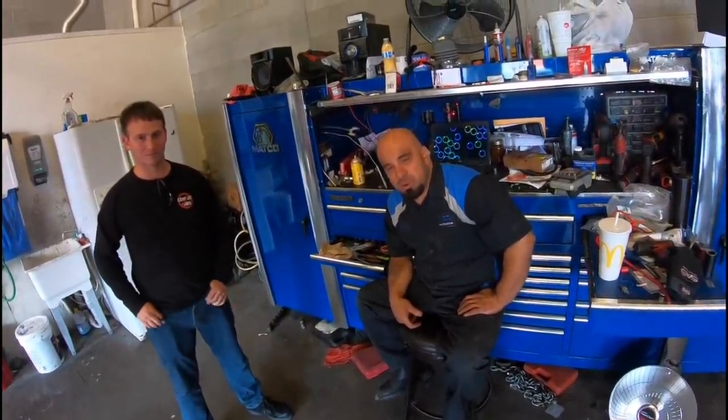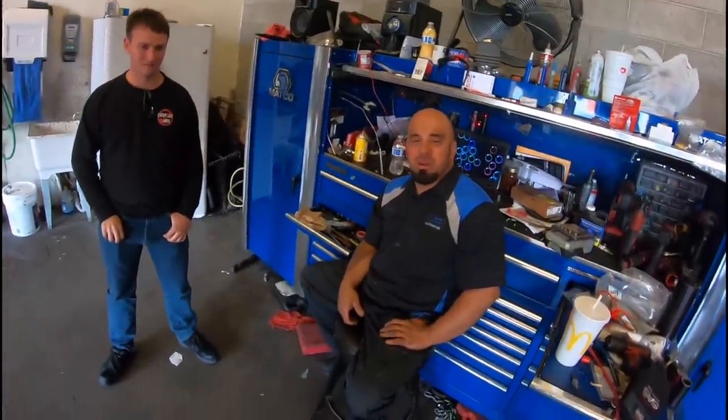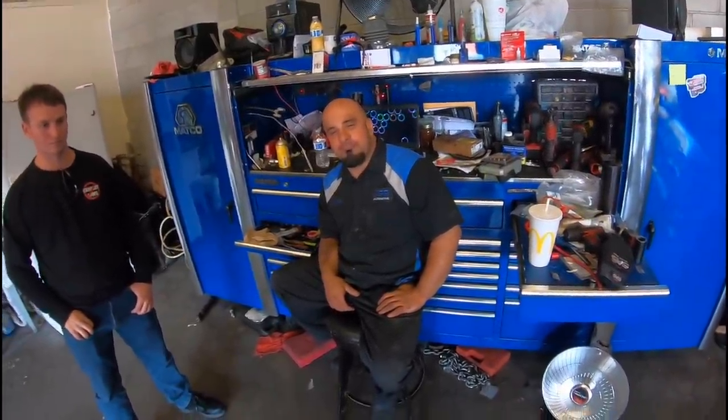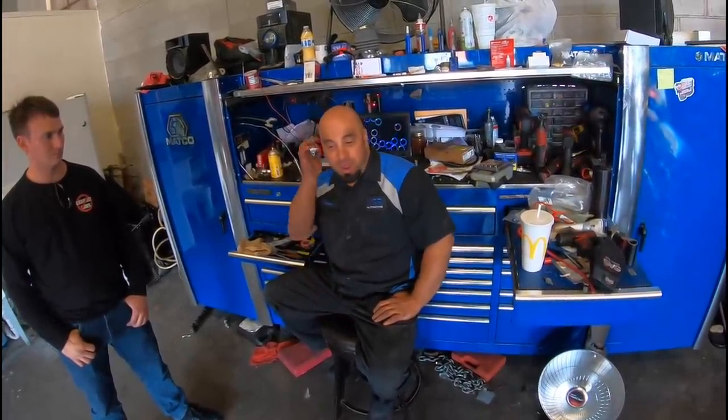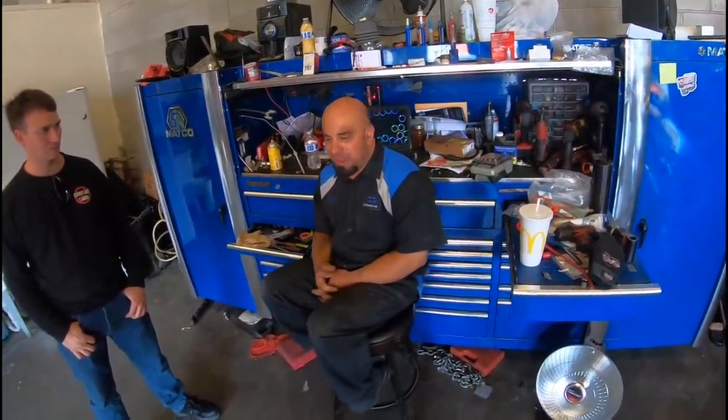What car do you have? I have a 2014 GT500. And what do I got to do to get the 1,000 wheel horsepower? Because I'm trying to build it after the wide body. Right now it's maxed out at 833 wheel. I just want to know, what are the weak components? Is it the rods? I've heard the rods, the block. What else is the weak point of that motor? Do you have to re-sleeve the block at 1,000? Not really. No.